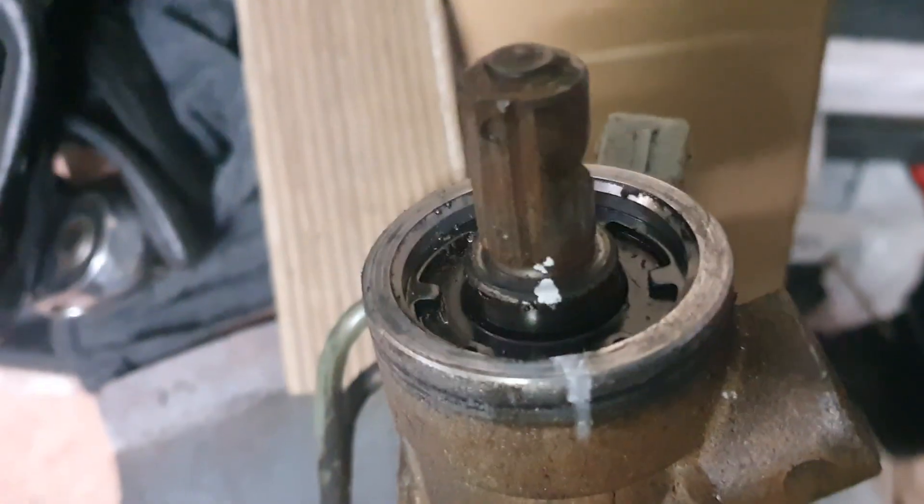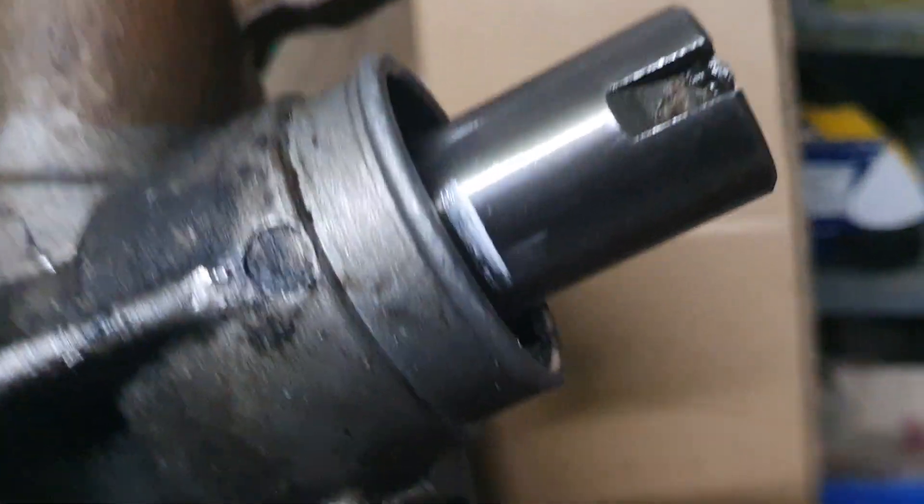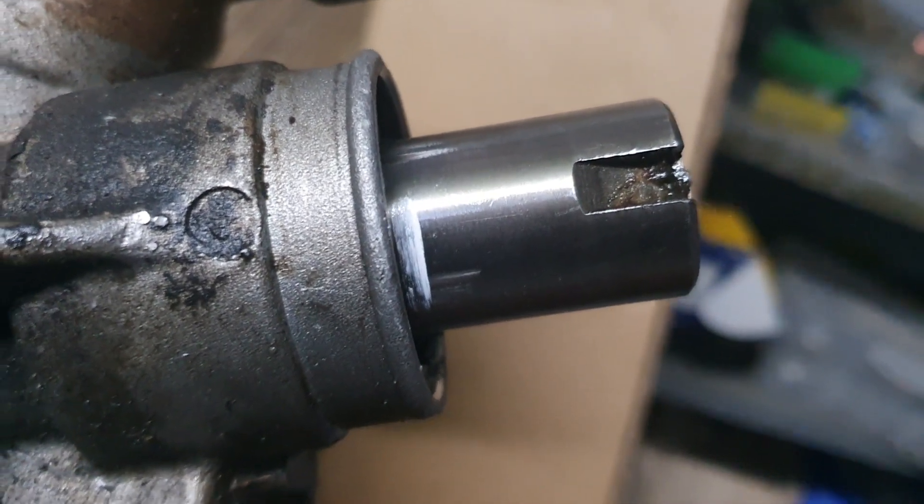Passenger, driver — can't really make any mistakes there unless you're in a different country. Alright, I'm unscrewing the inner tie rod and the thread is coming out. So before I start pulling the rack apart, I've marked it up to the position that I'm going to try and get it back to when I put it back together, so I know it's all in the same spot. I've marked up there and on both of these you'll see that they are in line.